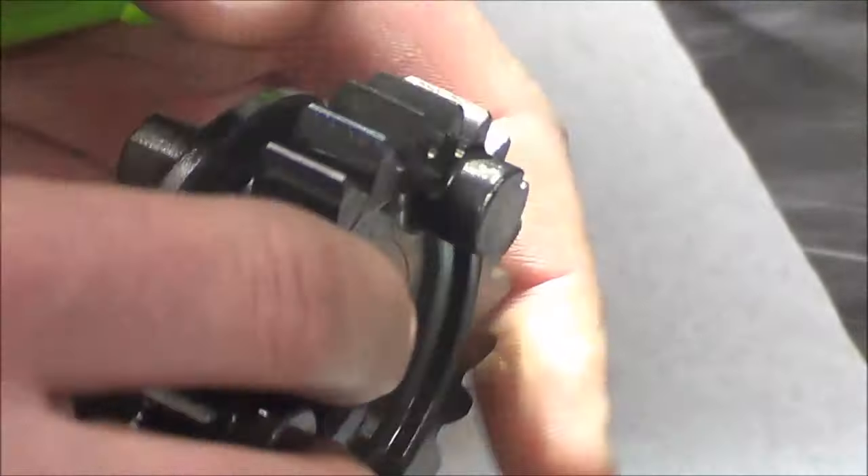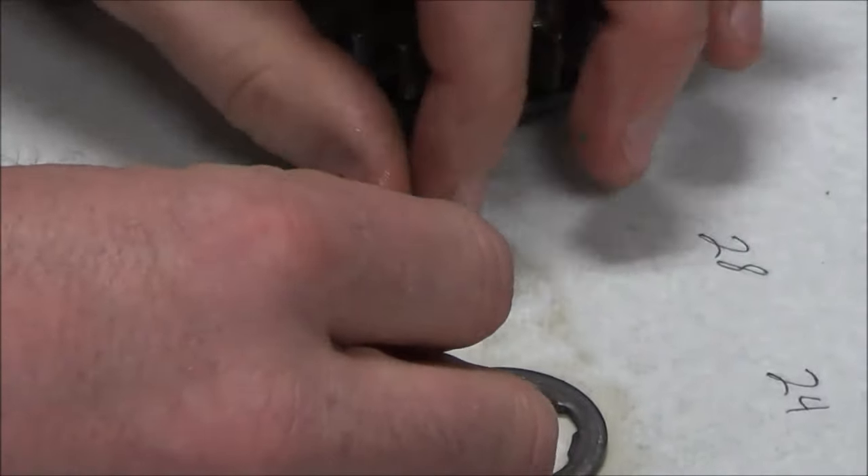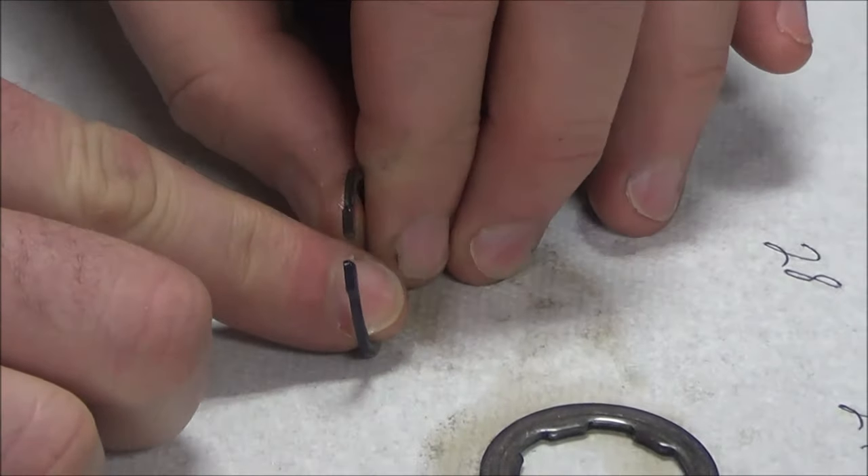Snap rings are always a one-time use. What we're looking for is to make sure they're not bent or twisted real bad — we aren't even going to chance it, we're going to put new ones on. Would you say Brian and Chris did a pretty good job taking this apart? Yeah, because it's not twisted real bad. Minimal distress is what I'm asking for on the lab sheet. We literally just want to lightly drag this off the shaft it's coming off of.